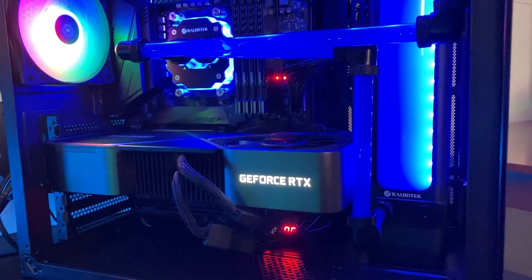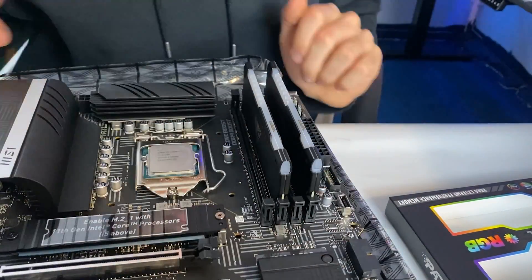So when should you buy these new chips? If they become the only option available, you should buy them. If you're exceeding 32GB — or think you might even occasionally exceed 32GB — they're a good buy. They're better than the 64GB kits if you're after performance. However, right now the market is strange: sometimes you'll find lower-clocked 64GB kits for less than higher-clocked 48GB kits. In that case, if you're a PC flipper, buy the 64GB because more RAM makes the PC easier to sell. But if it's for your own use and performance matters, buy the 48GB. If you just want more RAM and can compromise slightly on performance, try to gain some back with overclocking.